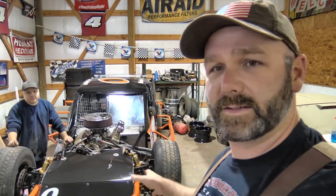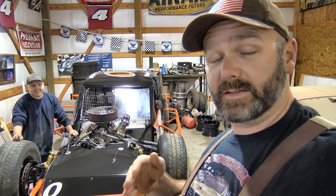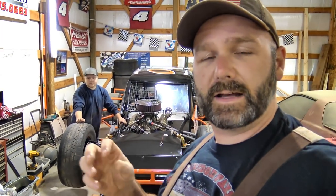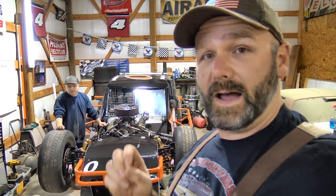Nathan was telling me he was working on his car down at the racetrack during a practice day. Whenever he went around the turn, he was losing oil pressure. As he let off the gas, the oil pressure light would come on inside the car. He took it apart and found that the little nozzle that comes off the oil pump and goes down into the bottom of the oil pan had slipped off — it had vibrated off. He got that fixed, but it kind of messed up some of his bearings just a little bit. We'll go over there and take a look at those bearings.